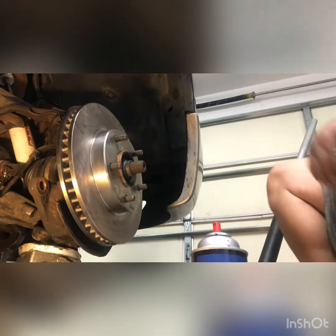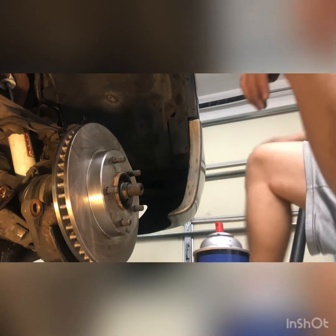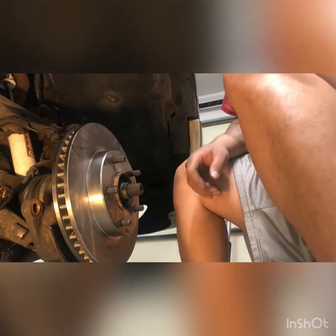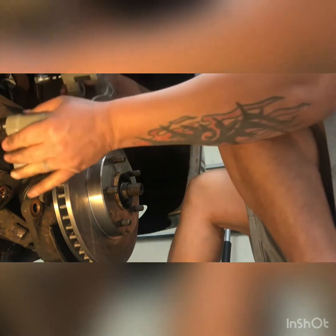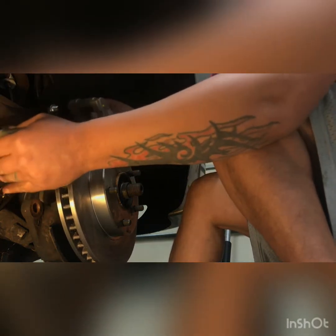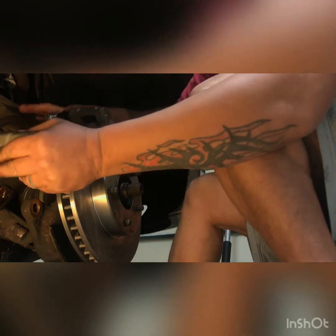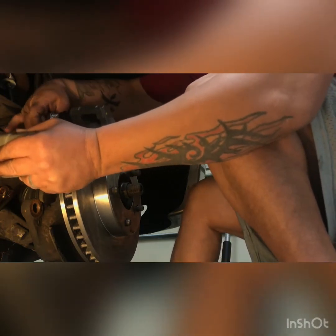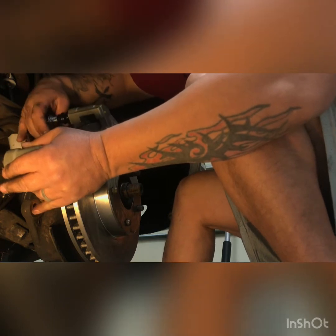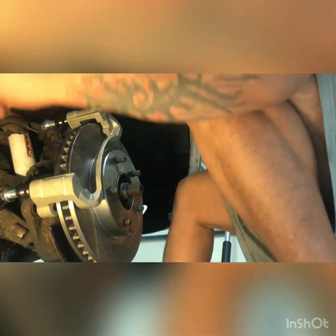Here's my light here. And I can lower this jack here because we got jack stands. Move my brake parts cleaner. Take this guy. Now you'll see this here. You see how it's rounded right here like this? That's the contour of the rotor, and that's what you want to marry up there. So move this guy a little bit. This goes down there. Make sure that's loose. All right, there's one right there started. And then we'll move this guy down here and get him started.